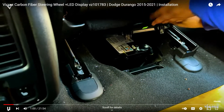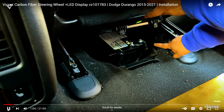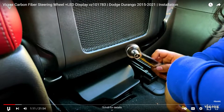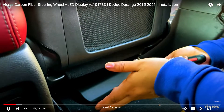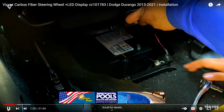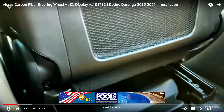So, there's your battery — if you didn't know, the battery's down there. We're going to go ahead and disconnect the ground so we can get started. All you need is your 10 millimeter socket, which is usually the one you're always missing. All right, that's done. Now we can go ahead and pop out the airbag.